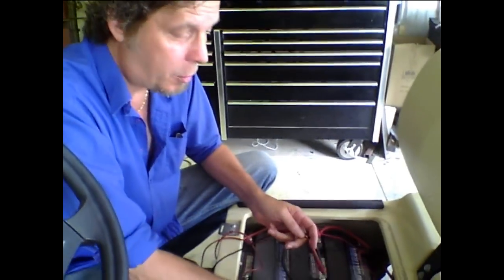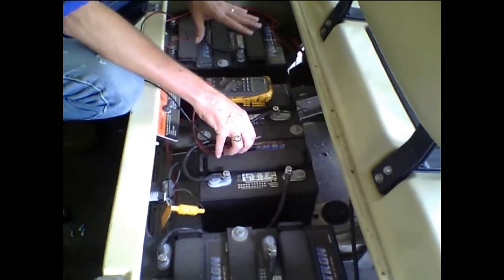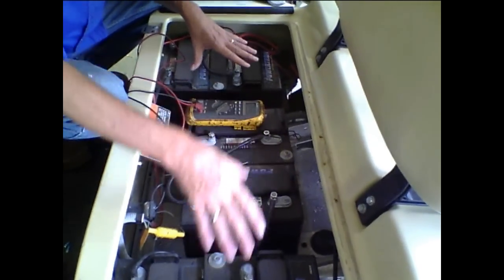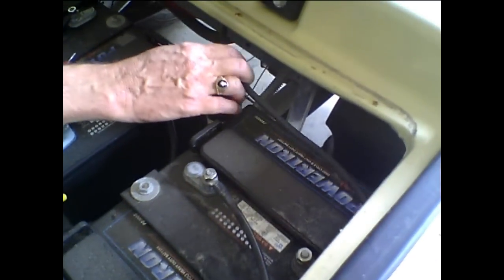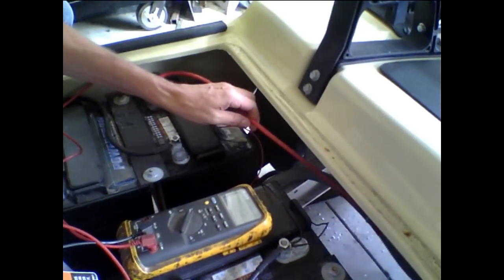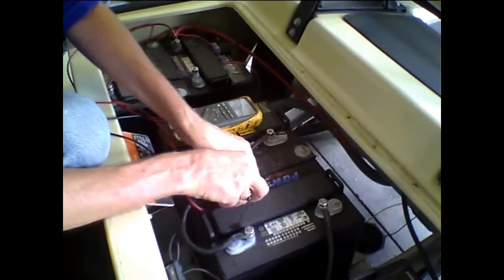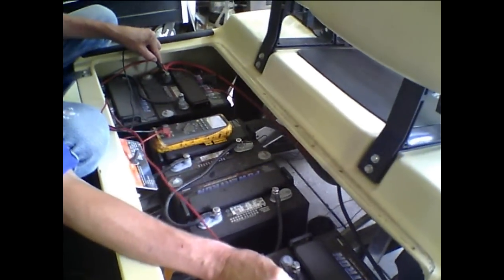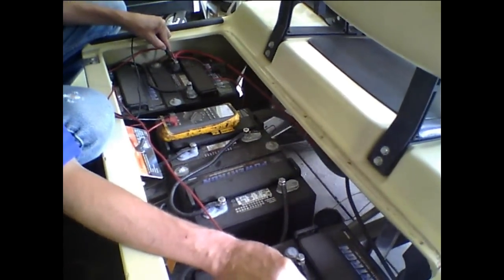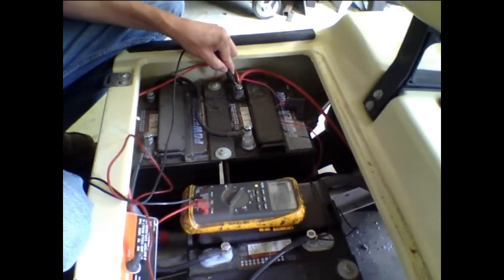It's as simple as finding the last two wires coming off our battery pack. This particular cart is a Club Car. On just about all Club Cars, you're going to see your two main wires coming off the batteries — one on the driver's side, one on the passenger's side. These are headed back towards the motor, so if we take this and probe both ends, our meter should read over 48 volts. Right here we're showing 48.4, so we know these are the two batteries we need to hook up to.